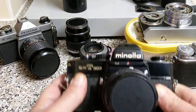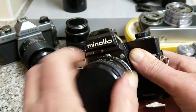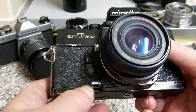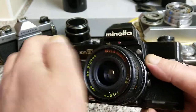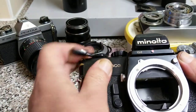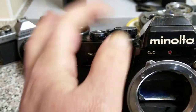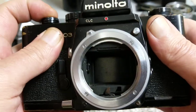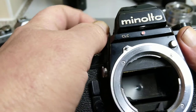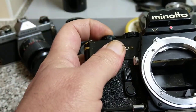And finally this week — this is the top of the Minolta range, this is the 303. Not the B's; the B's were slightly dumbed-down versions. This has got a Bell and Howell 28mm 2.8 on it. It has some issues as well. Sometimes the shutter sticks up — it doesn't want to work reliably at all speeds. You can see it's been well used. The shutter stays up at certain speeds, and now the mirror doesn't want to move. So yeah, this has got a variety of issues — but that's another repair job.